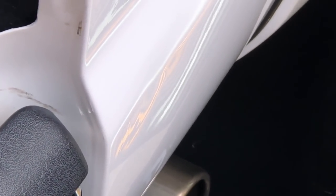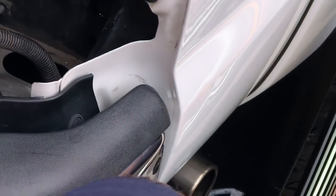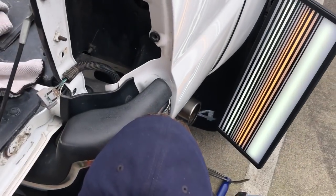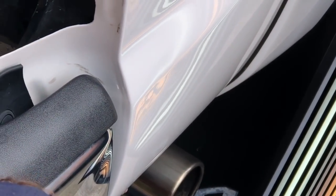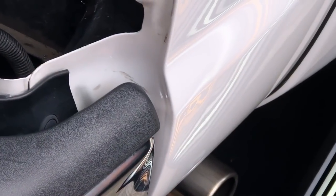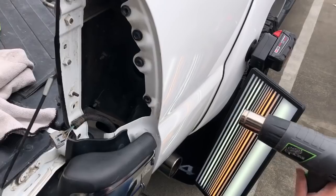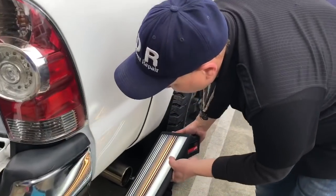Let's go right along this body line and straighten this little part out. This is the toughest part — it's not that it's very difficult, it's just a lot of work, a lot of patience. This is probably the most difficult part out of all of it, being that it's on an edge and it was crash damage. I want to get a little wider line so I can see more into it. I'll come through and make some really strong pushes right through the middle. We'll put the tail light on and when we're all done we'll come back and show you the whole end result.